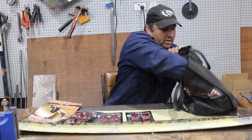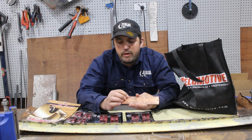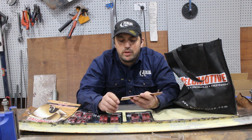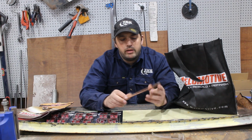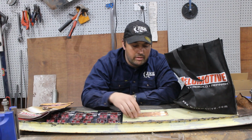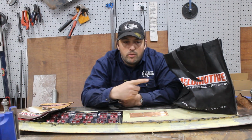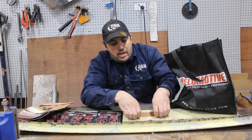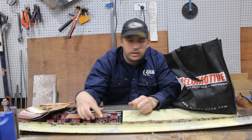Other things I've got is this copper block. It's 3mm thick, and it's got ridiculously strong magnets pressed into it. So when you've got a join in the sheet, you can put that up underneath the back of the panel, do your weld from the front, and it will help absorb the heat out of the piece. Should be a handy thing.